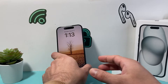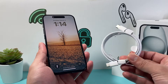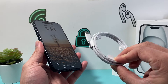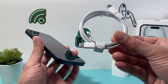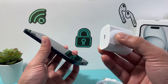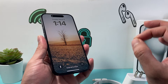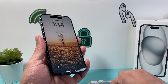If it doesn't turn on, it's time to figure out if you have a bad charger or a charger that's not charging your iPhone. Make sure you're using — especially on a new iPhone 15 or newer — the Apple-branded charging cable. New iPhone 15s have USB-C, so use the original cable and get one of these 20-watt blocks. Don't try to charge with your computer or smaller 5-watt adapters because the newer iPhone requires a lot of power.